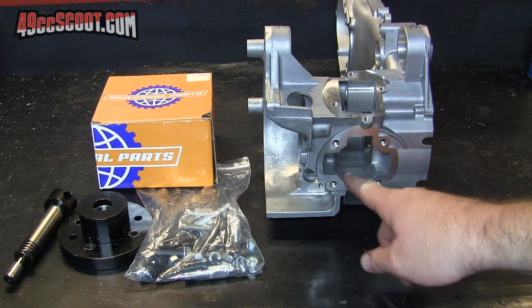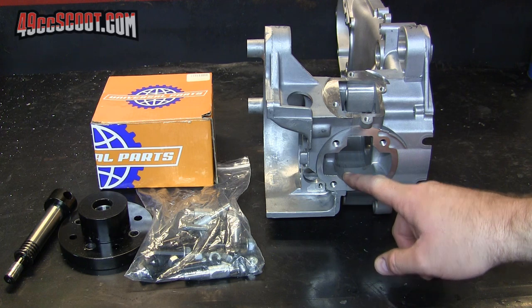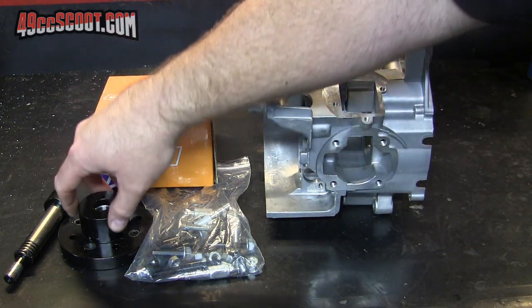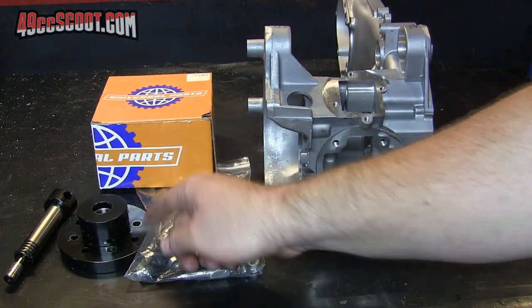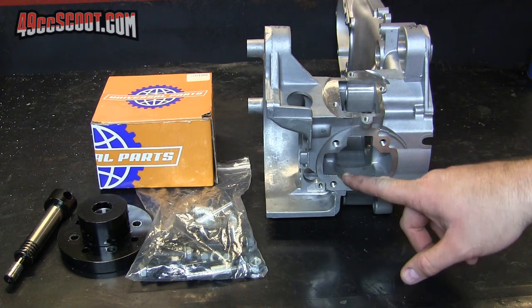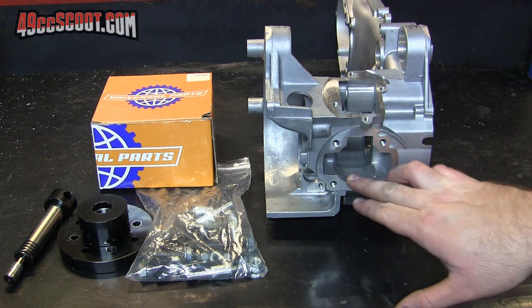Next up, I've got to focus on getting the bore here to fit the cylinder with this TPR 86cc. So I've got to bore this out to roughly 56.7 millimeters. And I have a case cutter here by Universal Parts that I've also made some of my own adapters for to work with the Minarelli. And again, I've got another video on that that I'll link in the description. But let me get this all set up and start cutting.